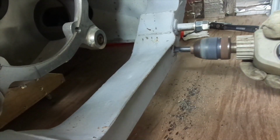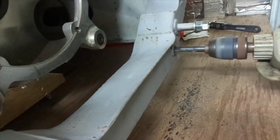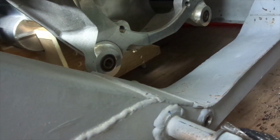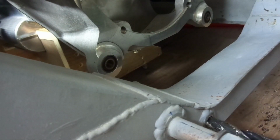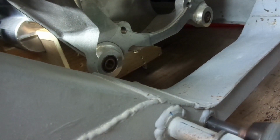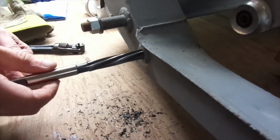And we're through. So then I move the drill in and out, almost honing the hole, in the hopes of increasing the diameter a little bit to get the reamer in. So I thought I'd just do the other side as well. So just make sure the hole's possibly just a little bit wider, give the reamer a chance to get in. So let's get reaming.